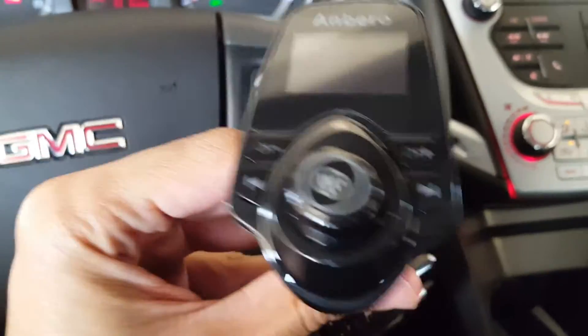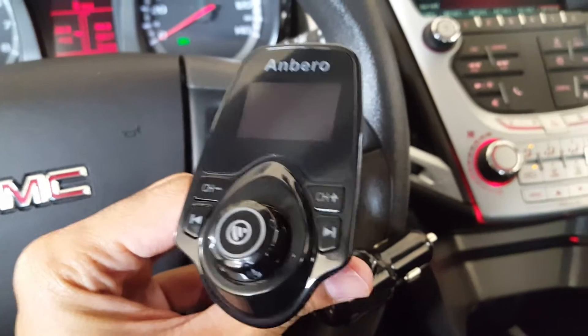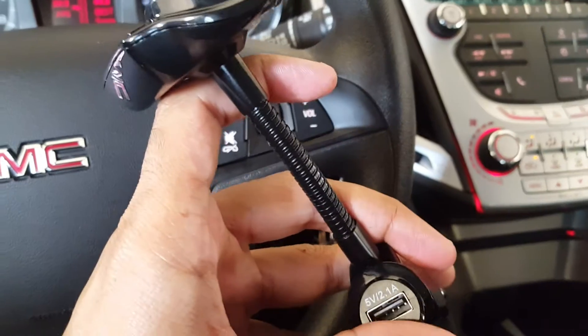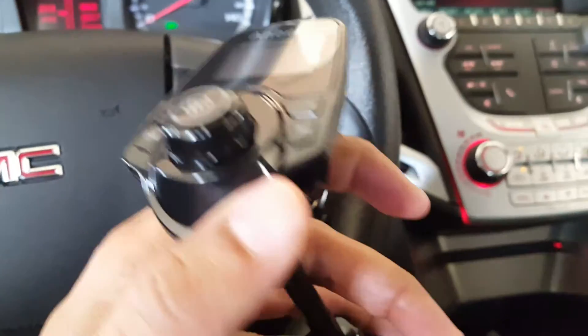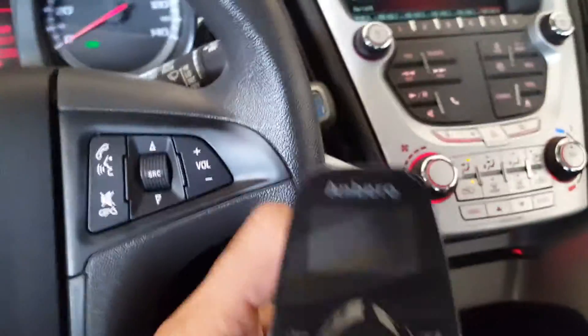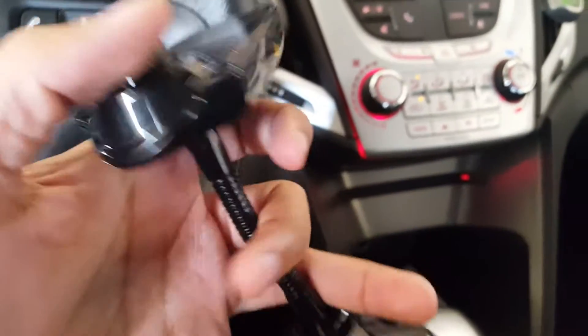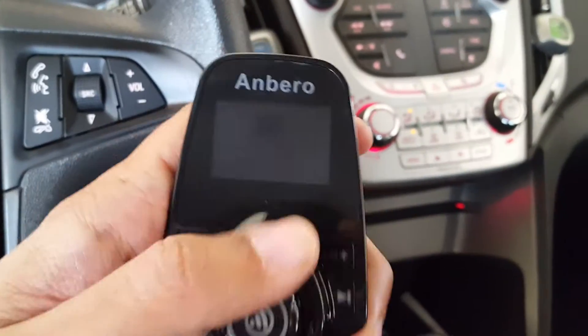Before I actually go ahead and plug it into my car, one thing I would like to stress is that when using these kind of FM transmitters, it is really important that you set the right frequency when you plug in and connect. You should really hear little or no static. If you do get a lot of static, you have to try another frequency. In my case I found that 107.9 worked best for me, but it may change depending on where you live. This is really critical for optimal audio performance, otherwise you are going to get static or bad sound quality.